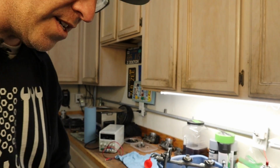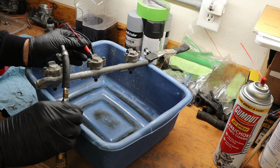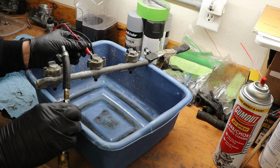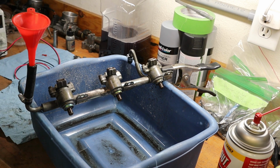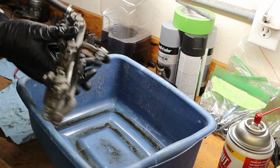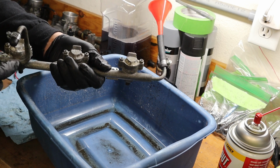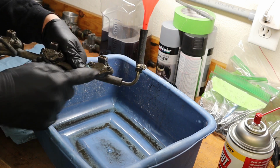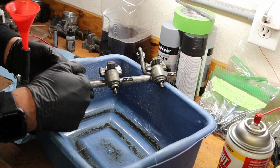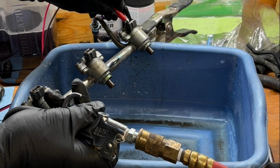Sounds good on paper. We'll test it. All right, so we've got voltage. Just gonna give a little pressure. I made one little change to the setup that switched the sides that I capped. So this side acted like a toilet J-tube, and so the air would get caught when I tried to fill it. So this way I can fill it, get all the air bubbles out, and get more of the carb cleaner out. A little air, a little power, a little carb cleaner.